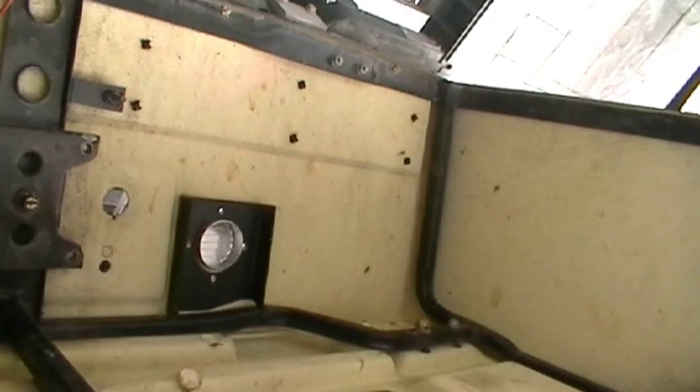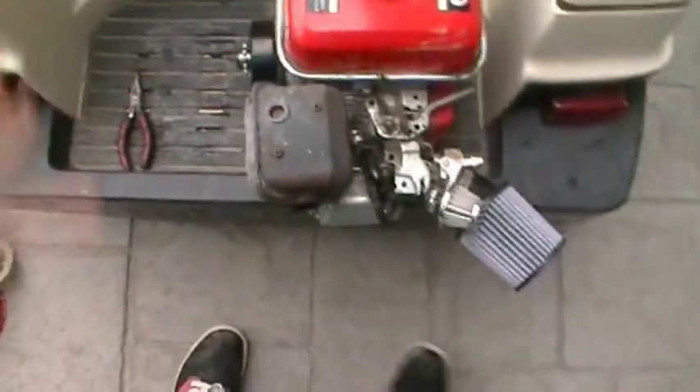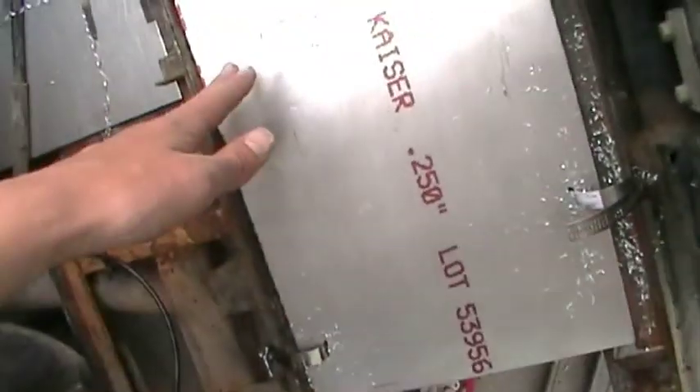After that it's going to be completely in place. I already know how it's going to line up with the sprocket, because I slipped the clutch on there and placed it where I lined it up with the very tip of the spline at the end. It doesn't even need to go all the way forward. So I'm going to drill this last hole and see you guys in a bit.